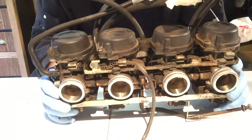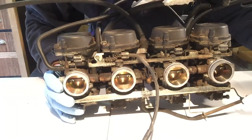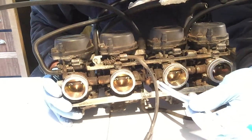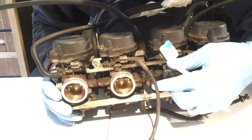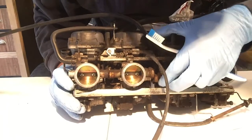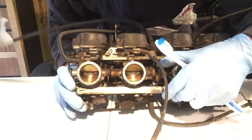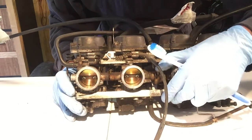Right, so this is it. Things I was looking for. This is the idle — idle screw that goes in the back, over here. This is the throttle. So when you pull on the throttle cable, you can see the butterflies going open — gets air in the carbs.